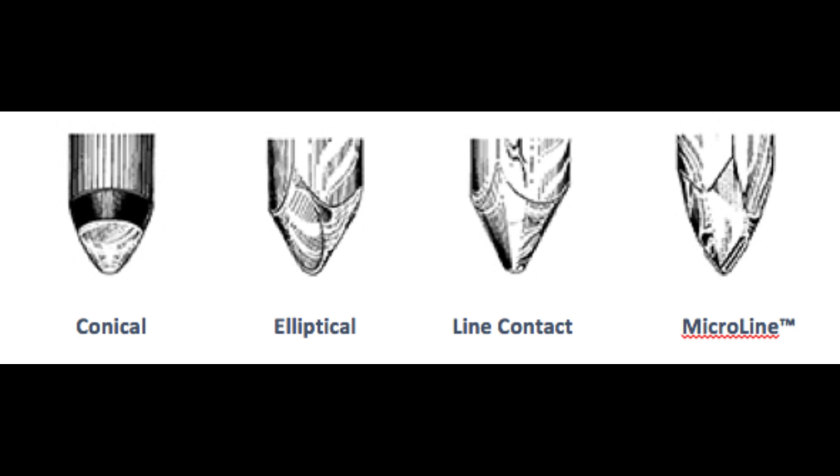Next up would be an elliptical. Everybody wants an elliptical stylus to play high fidelity stereo records. The idea is that the stylus is shaped somewhat like an American football with the pointy ends pointing on either side of the groove. As that groove moves side to side — especially with high frequencies — the stylus slips through the groove easier. With a conical stylus you can get a pinching action where tight high frequency modulation causes the stylus to move up in the groove, creating audible distortion. The elliptical doesn't suffer from that, so theoretically it can be a lot cleaner and give you a lot more detail.